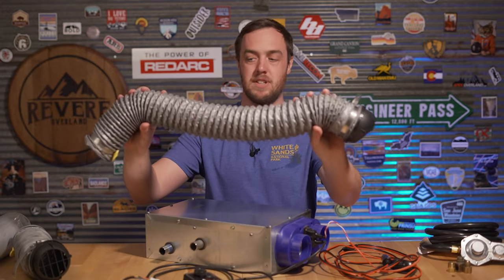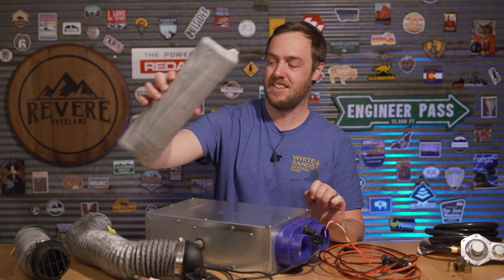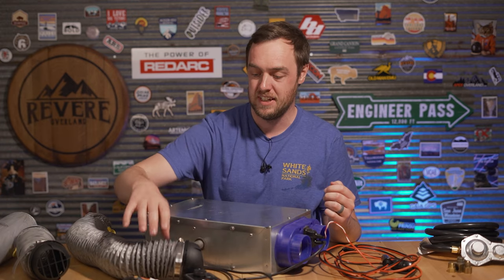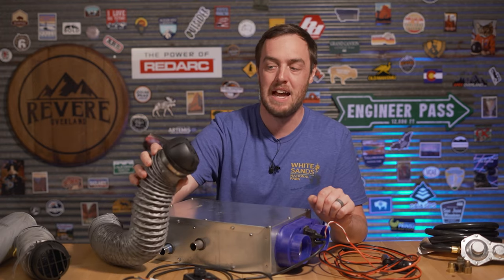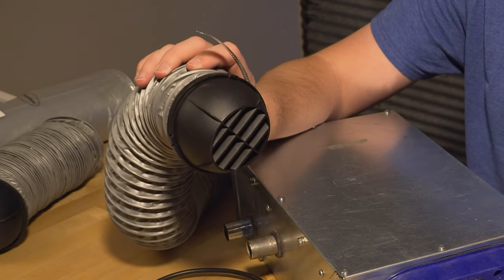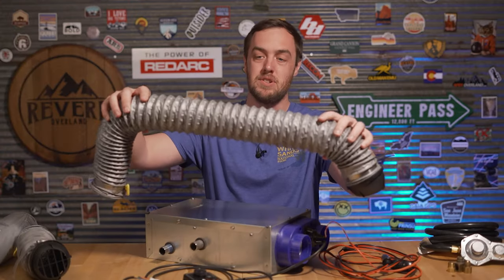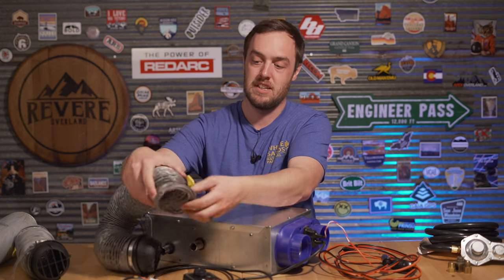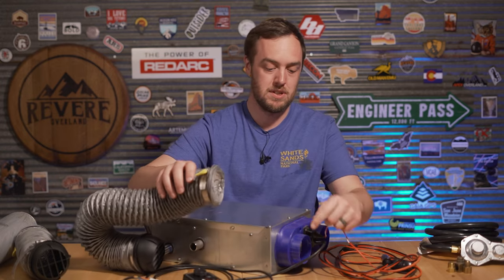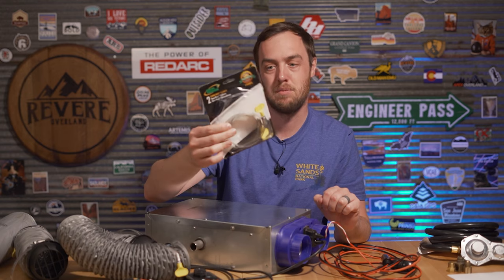To replace the ductwork that came with it, I bought three-inch ducts that come in a 16-foot section like this — I just cut it down to what I needed. I put these vents on the end. I really like these vents; they actually came with my diesel heater and I have not been able to find them since, so if you're able to find something like this, drop a comment and I'll put it in the description. The duct is uninsulated, so you do lose some heat, and you want short runs if possible — but it packs up really small. Everything's held together using thumb-tightened hose clamps, and I'll put links to those too.